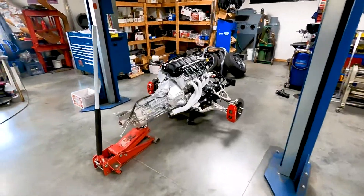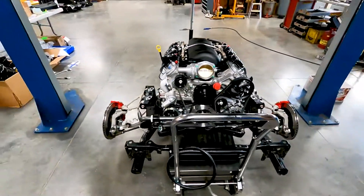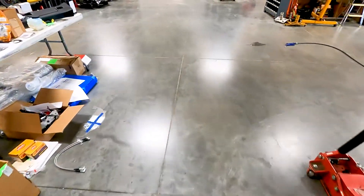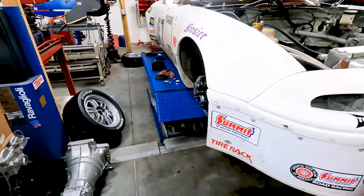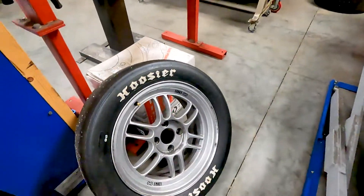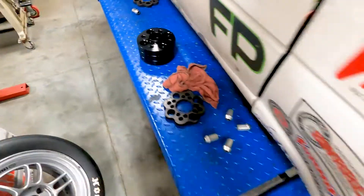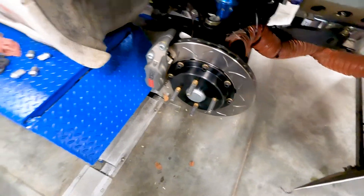I don't mind this thing sitting here because it's pretty awesome to look at. If you didn't see it last week, go back and watch last week's shop tour — I talked a lot more about what was going on and all the modifications that have been happening to make this happen. Here's a little tip: if you're going to run these Stop-Tech brakes on your Miata and run Enkei wheels, which most of my guys do, you have to run a one-inch wheel spacer, which means you need slightly longer studs. These are pretty long studs, but they make some that are slightly longer.